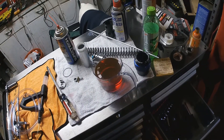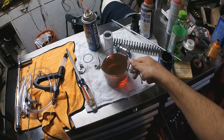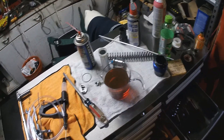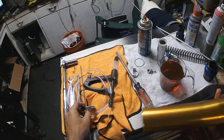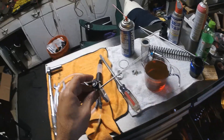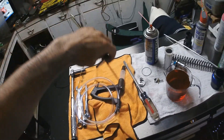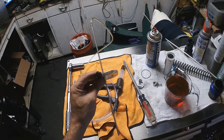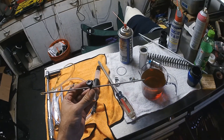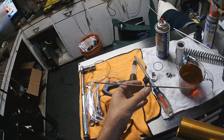So this is some fresh 10-weight fluid. The original fork had 475ml in it, so I'm going to pour in 500 and use my fork oil height setting tool to draw out the excess. That is set at 150mm of fork height. Thanks to Comfy Sofa who posted a link to some very helpful front fork settings for these forks.